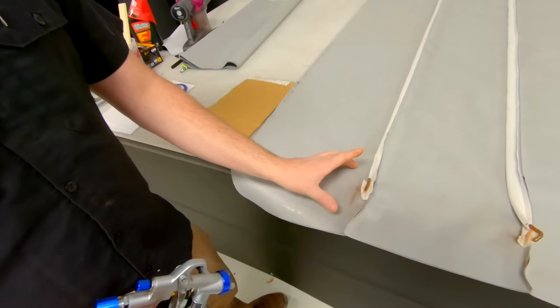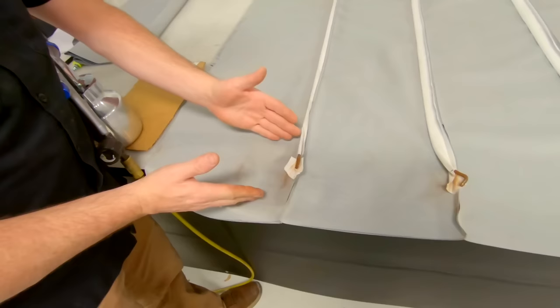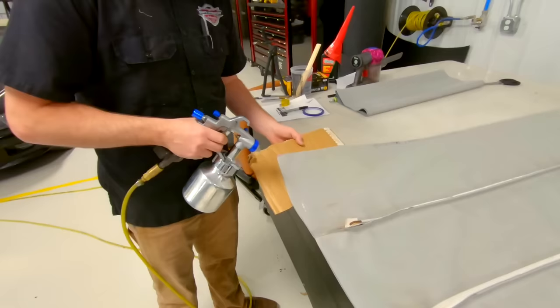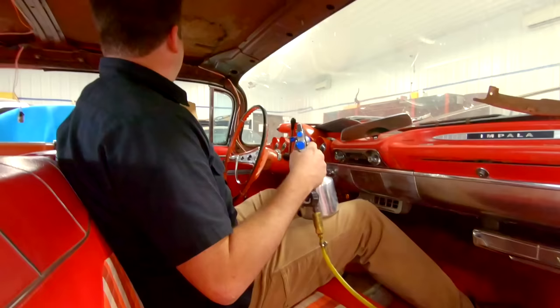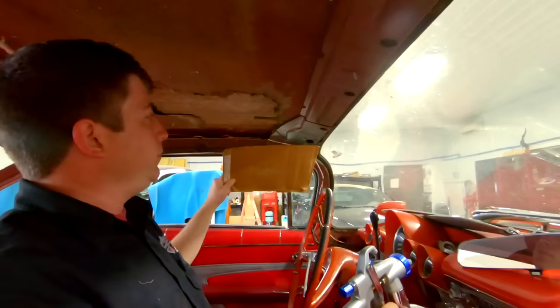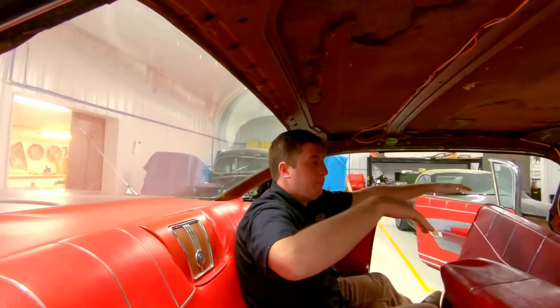With glue it'll actually just pull it down, move it out, hold it in place, and then you can run your staples at the very end once it's all tight and looks nice. We'll go through and spray around the whole edge — actually go up a little bit higher than what you think, because once this is in here and we're pulling it tight, it's not necessarily going to be right at the edge. So I'll probably spray two to three inches above where the end of the bow is. Then the second part is we'll spray around the edges where the tack strips are in the car, so make sure you have a little piece of cardboard so you don't get it all over your trim.